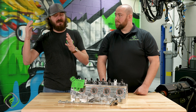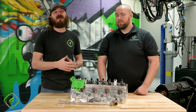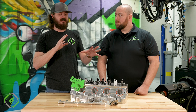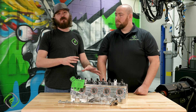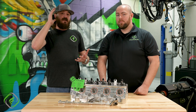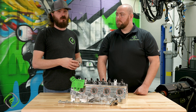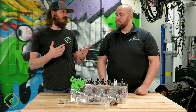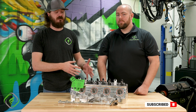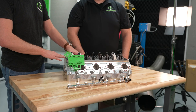The benefit is you get more lift, but we're speeding things up, which means we increase wear, and durability starts to come back down. There is a happy medium. The 1.8 stuff has worked in 90 percent of applications, however if you get limited due to crankshaft size or distance from crank to cam centerline, you can only put such a big lobe on the cam tunnel — usually the limiting factor — so you've got to increase the rocker ratio to get higher lift numbers to take advantage of a high flowing cylinder head like this F-710.